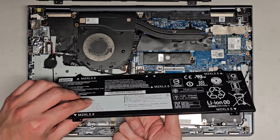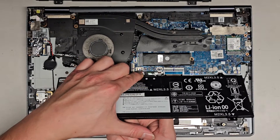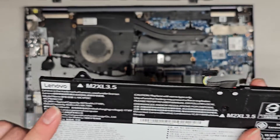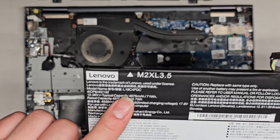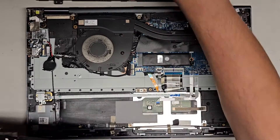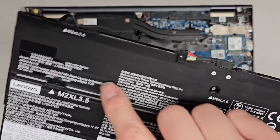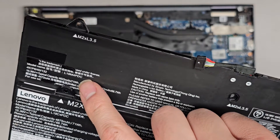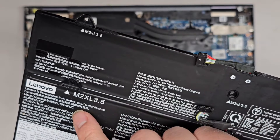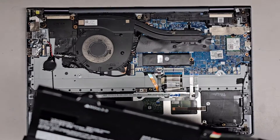What I do is I get my finger underneath that connector, one on top, and we kind of wiggle side to side as I pull — just like that, and there we go. So there's the battery connector. Battery model number is right here: L19C4PDC. Hopefully it's the same because I went by the laptop itself. This is different — L19M4PDC. This one is L19C4PDC. So it's different.